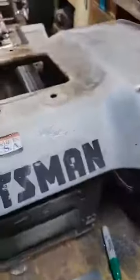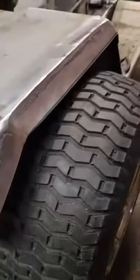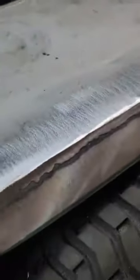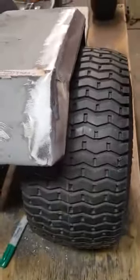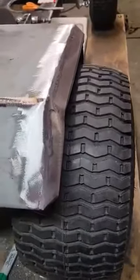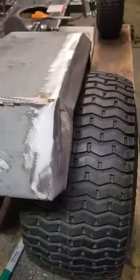As you can see on the floor there's plenty of grinding grit from today — this floor was swept earlier. So let me show you what I am happy with, and that is this. They're about one inch from the crease, the angles match the original angles. I have another set of fenders outside — a whole other parts rig — that I used to make sure the angles were correct.